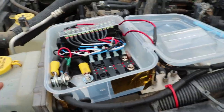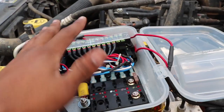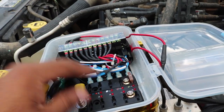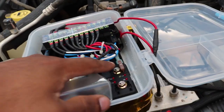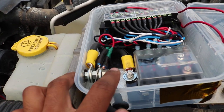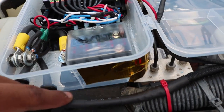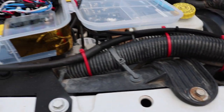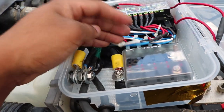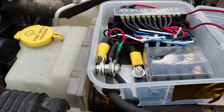Bleeping Jeep has one too — it's a little more complicated where they use a Cherokee fuse box, but it's pretty much the same exact thing. The main essentials you need are a container or a plate to put all this stuff on, this blade fuse holder, relays, and a distribution block — and a lot of wire. Right now I just only have those reverse lights wired up. It comes with a nice little cover. For negatives, I just made a post in my lunchbox and put a screw all the way through — primary ground right here, this four-gauge wire — and I ran it to the body ground right there. Then I just have this one nut I can take off and add negatives for the relays, and I don't have to touch the main any time because I have that double-nut system.